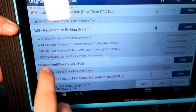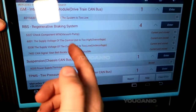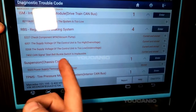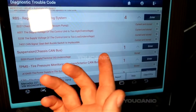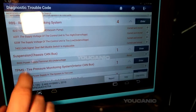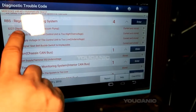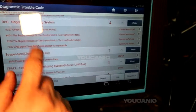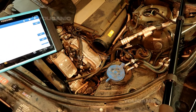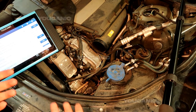We also have a few other codes: supply voltage too high and supply voltage too low — so we've got over-voltage and under-voltage codes. There's also a seat belt buckle switch issue, which is showing up here because it's affecting the hybrid system. But the first thing you want to focus on is the vacuum pump M56, which is that component right there. On a Mercedes it has this designation, but other makes and models will have different names though the concept is very similar.